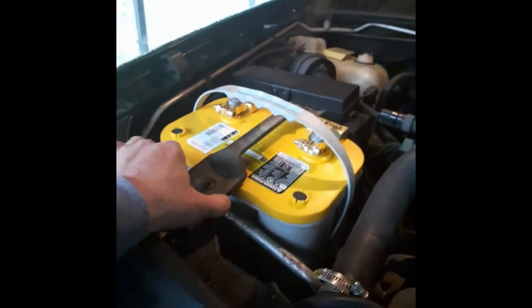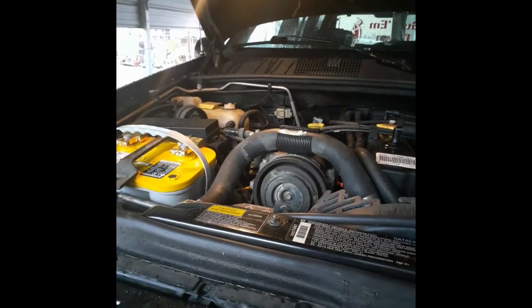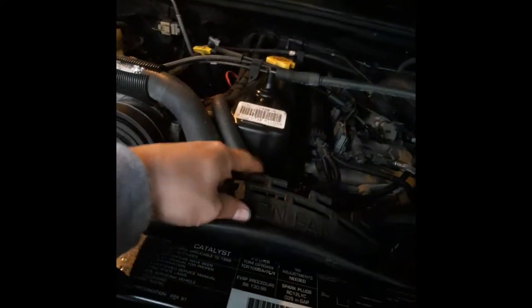I did a new battery tray and holder yesterday. It needed a kick-down cable — a TV cable — and that helped it shift great. Other than that it does need a new radiator shroud eventually, but it is what it is. It has a Rubicon Express track bar, you can see it, and all pretty new steering components.